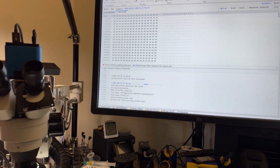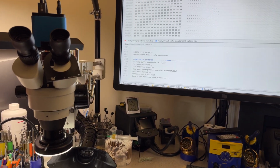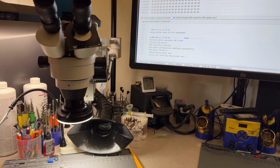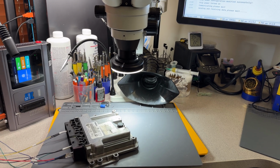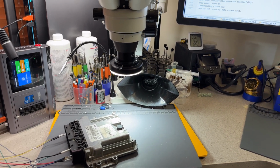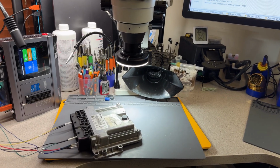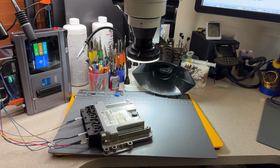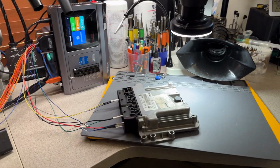Again, all I'm doing this for is to make sure that there are no errors reading the device, which is very important. So you want to read first, because if there are any errors and you're trying to just write, then it will be a no-good computer for nothing. So I'd rather always recheck, make sure that I can read the files and everything is going smoothly. All right, so let's see how long it's going to take. I think the flash is super fast in this one too. Luckily for me, the Mini Coopers are a little faster sometimes in reading. When it's about writing, it takes up to 1 hour per writing. All right, so I'll be right back.